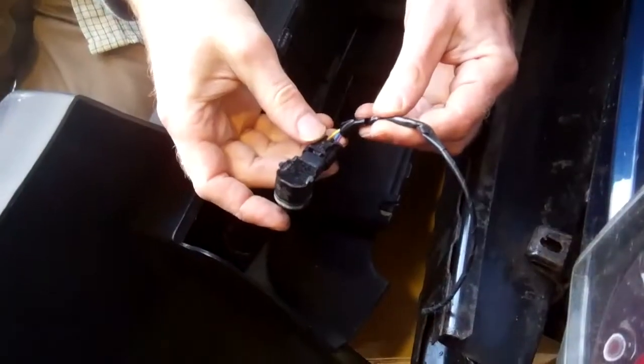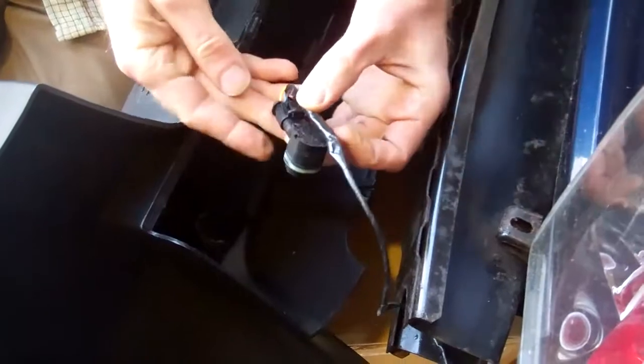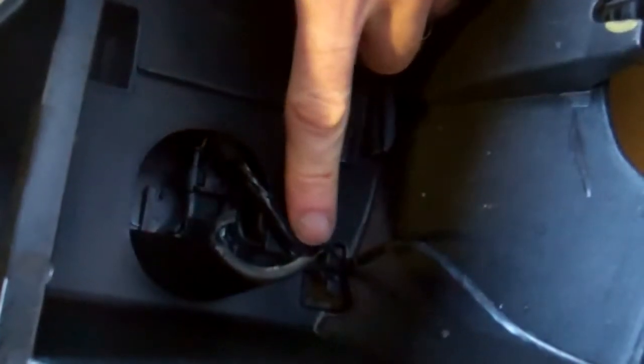So we're now ready. We'll manoeuvre the bumper next to the car and connect it up. This might not come out too well on the video, but we'll show you the basic plan. So basically you need to double over the connector, the wire, like so, and then you need to tuck it in behind that outer skin and then get it square, so that there we go. Right, and you want to try and keep it square. So I've got my finger on the front guiding it in square. Ian just had a go and creased up the grommet. Okay, and then they just push in, and then you see the cable route in there. You might want to leave that for later, but it clips underneath.